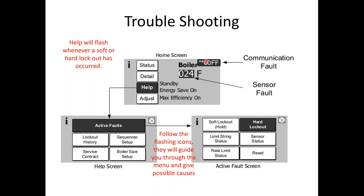The star-star-00-FF is a communication fault — it's a 50-50 shot: either the control stopped talking to the display or the display stopped talking to the control. In some rare occasions the harness is loose, especially if it happens right out of the box after shipping — the green communication harness usually just needs to be plugged back in.